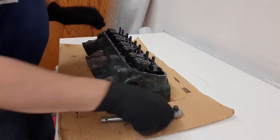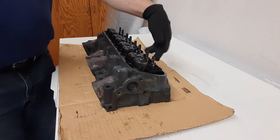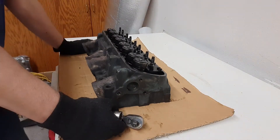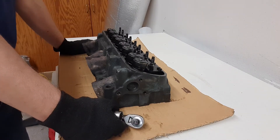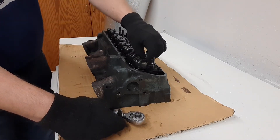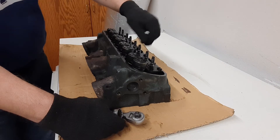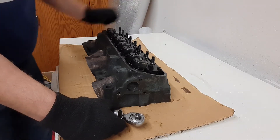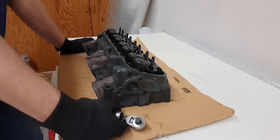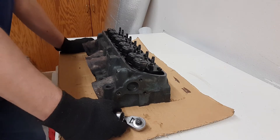I'm going to pull off these brackets here. These are stud rockers, just 1.5 ratio — I'm not going to go with a roller rocker cam, but these weaker Pontiac ones where they taper down, I'm probably going to change them. They've been in use for 50 years, so it's not going to hurt to change them. I want to go to something that's going to hold up. I'm not going crazy on horsepower, but if I'm going to have it apart, why take the chance?